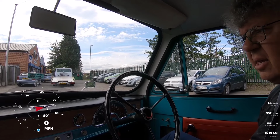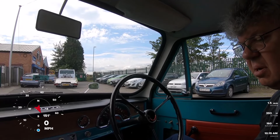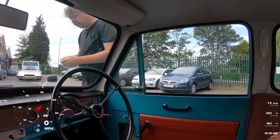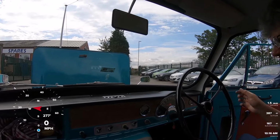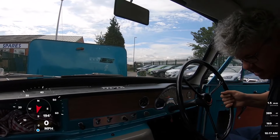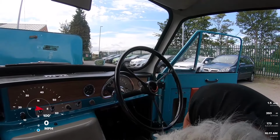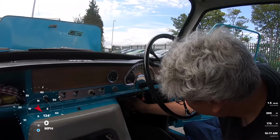I guess you lost all power. Yeah. It did somewhat similar to that last time, didn't it? You remember? It's as it's got really hot. Well, that's not gone well. I was just checking to see if the vacuum pipe had come off the distributor. The accelerator cable is fine. It's done it as it's got to the point where it's getting hot.